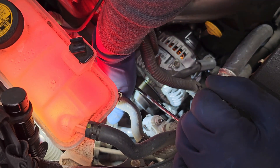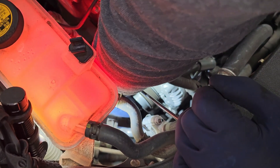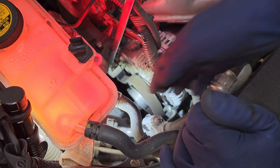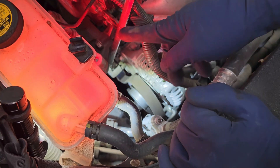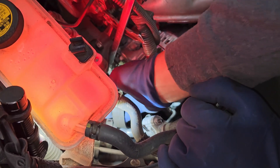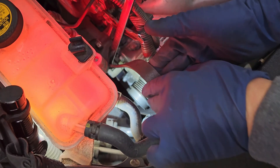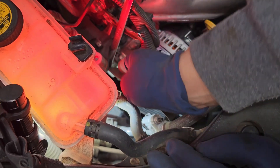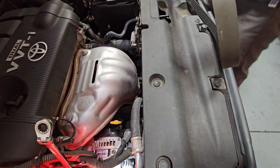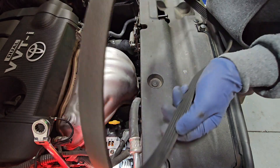Under the alternator there is a water pump. So I'm going to go ahead and slide the belt off the water pump because that is a smooth pulley and it's actually a lot easier to remove that. Now, your tool is going to get stuck once releasing the tension — don't remove your tool, just keep it on there. Then you're just going to shake the belt and slide it towards the wheel to get it off the actual crank pulley. Here's our belt — the condition of it. It's not bad, but we do have a hundred K miles and the customer requested it.